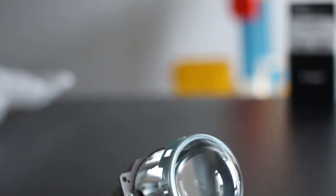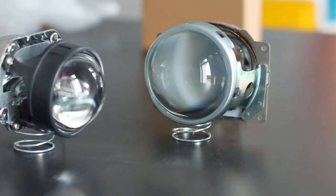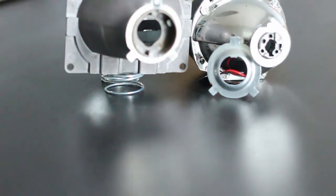The first component to HID retrofitting is the HID projector itself. Depending on what type of bulb size your car came with from the factory can determine whether your retrofit will be more of a plug and play or if modification will be needed inside your headlight. If you use an H7 or H4 bulb type from the factory, you're in luck in terms of having HID projector options for a plug and play retrofit. Our MH16.0s and our MD2S 3.0 are the two projectors that have adapters for H4 and H7 bulb types, so it makes retrofitting into your headlight a lot easier.